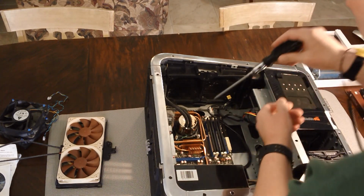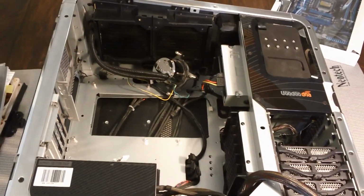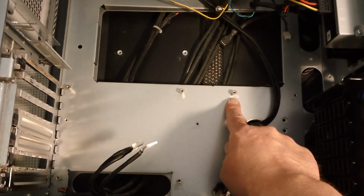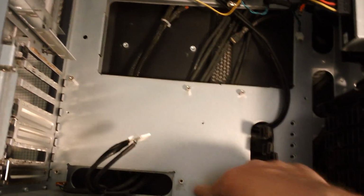And then we'll have to remove the cooling bracket. Okay, now you can see I have gotten the motherboard removed. I have it rather ingloriously over here. They're both ATX boards, so the spacers and everything are exactly the same. One of the nice things about just upgrading an existing installation is that you don't have to install these spacers in your case. You're all good to go.